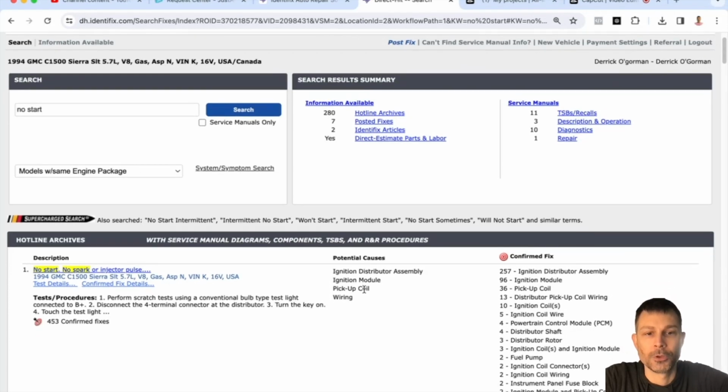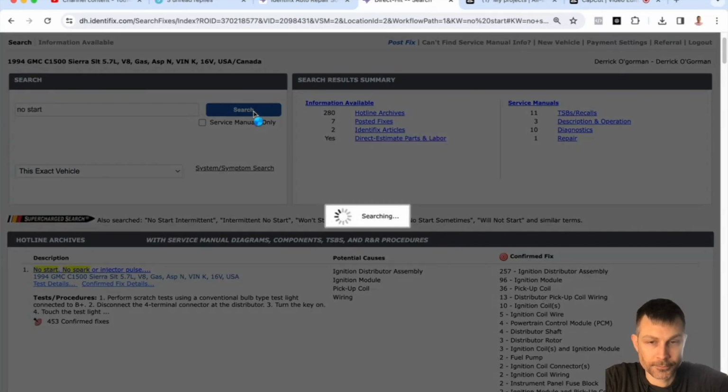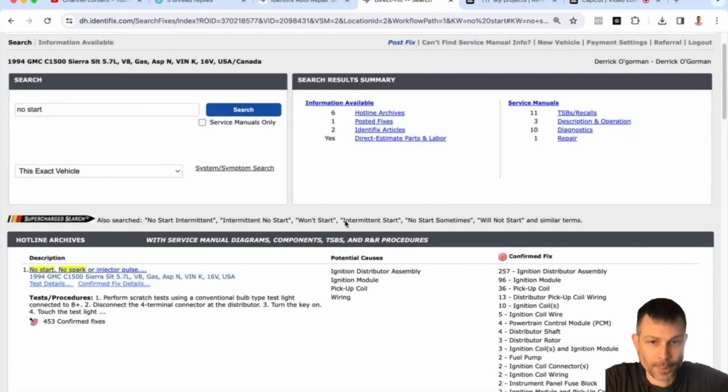Okay. So it just cranks and it doesn't start. Yeah, it's been fun. Have we checked for spark and fuel while cranking it over? I'm sorry, what? Have we checked for spark and fuel? I haven't since I've had all this problem, because I knew it wasn't a problem with that. Like I said, there's never been a check engine light. And this guy diagnosed it on his machine at Firestone, and that's what he told me. And he told you that the ECM was bad? Yep.